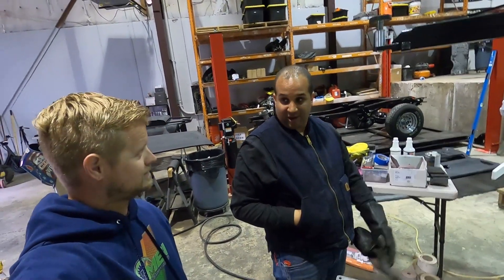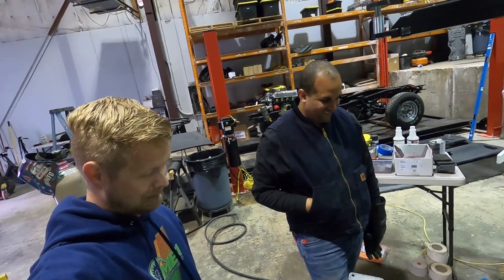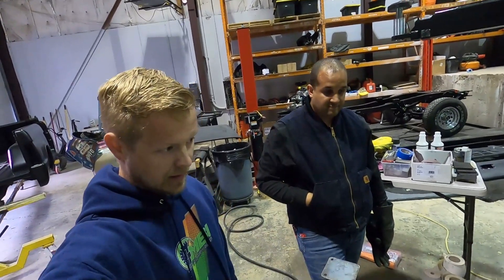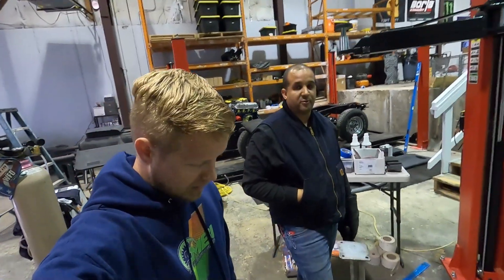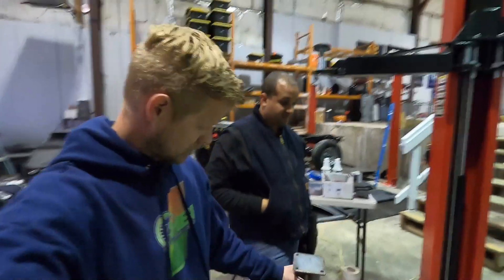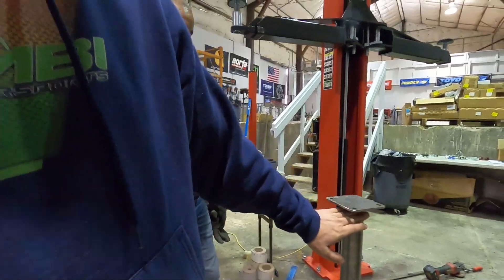Came out good. We picked this up from All for Fun Off-Road — I believe they also go by B&B Off-Road and Fab. Very happy with it honestly. We talked about earlier how the plates were already welded on at the proper length. One cool thing is that no two Broncos are exactly the same — they always have little tweaks here and there, even the new bodies. Because we're tweaking things the whole way across, one piece might be slightly different from another. With this cage, we welded the front crossbar and the two pieces together on the ground, then attached it inside. Once it was at the right height, we used a ratchet pole to hold height and a ratchet strap to hold it in place while we lined up the outside pieces.